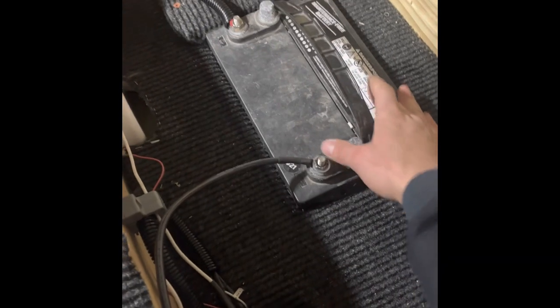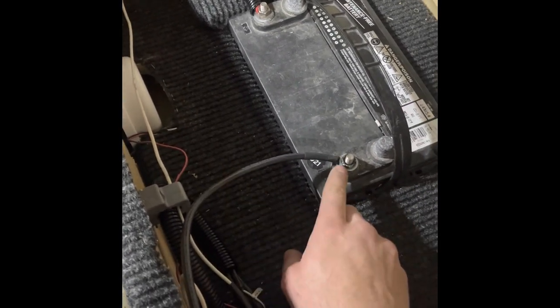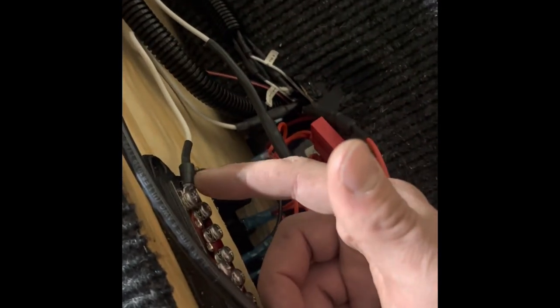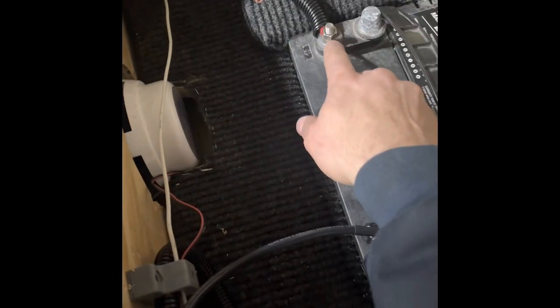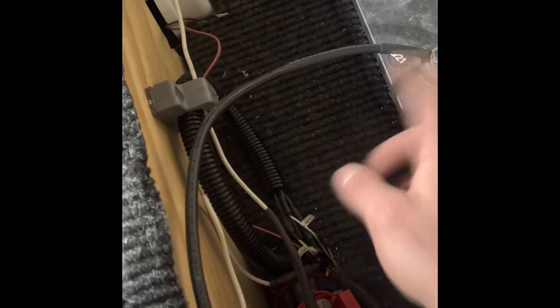The first thing you want to do is have a good ground. I have 8-gauge commercial grade wire — I've got that wired off with a copper connection. Heat tube runs here to what's called a bus bar. Basically it's a meeting place — you can have a positive bus and a negative bus. It applies electricity to the bar, which is all connected, and then you can just run wires right here. Otherwise you'd have multiple connections on your ground. So negative goes to the bus bar.